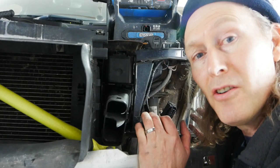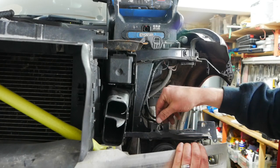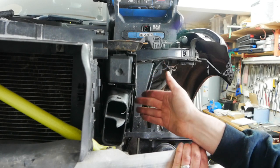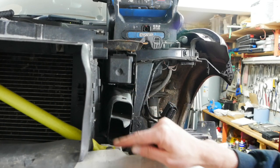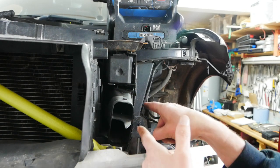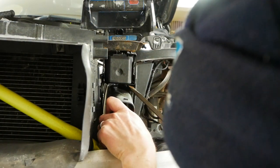Let's have a look and see what we can learn. The first thing is this tab here - you can see it's actually leaning back slightly. Because this side hasn't been smashed I assume that's meant to be leaning back slightly, so we can check that against the other side. Also, remember this upright from the other side where I said it should be absolutely straight - well it was pretty obvious, but that's confirmation. This is the air box feed pipe - I'm not sure if there's meant to be something on the end of it but it looks like there should be. Now that I've got access I can slide that back and clip it into the air box properly.